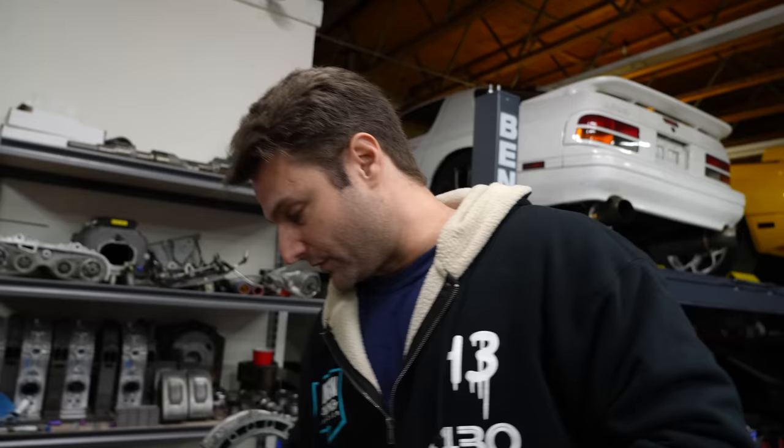Anytime our ignition system went up to its full 80 amps, it was overloading my power system because the fan was also going at once. So anytime the four rotor got up to full operating temperature, the ignition system would start cutting a little bit because the fans were on and I was just overloading everything. Ignition system doesn't need to do that, so we're about to see some really crazy shit.